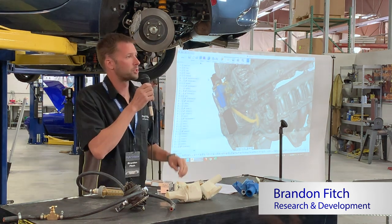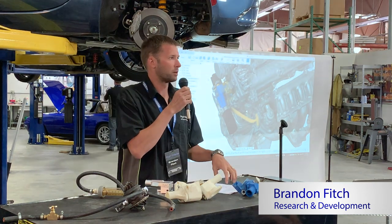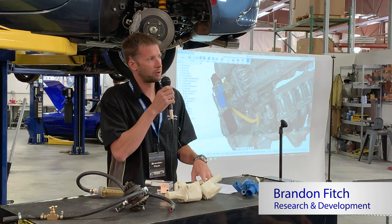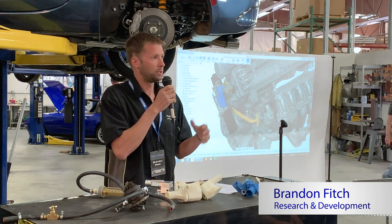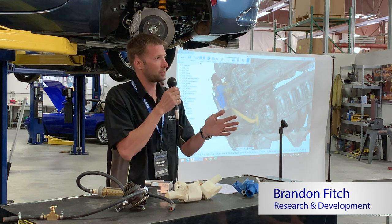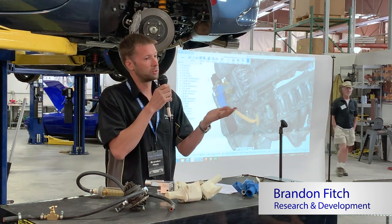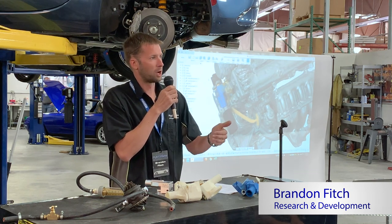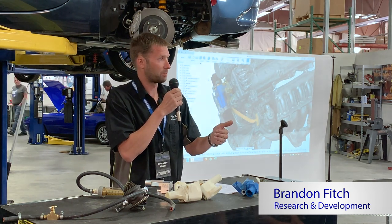A little more history there. The engine came out of a 323, a front wheel drive application to start off with. That had the correct routing. When they put it longitudinal, when they flipped it sideways, now there's no room, as far as Mazda's concerned, at the back of the head to have the coolant come out where it did in a front wheel drive application.